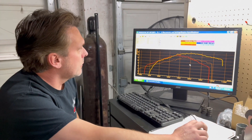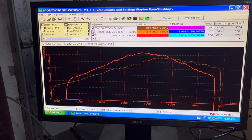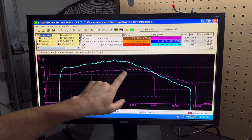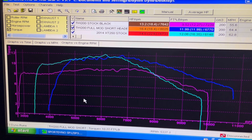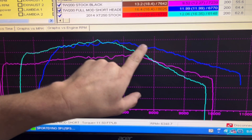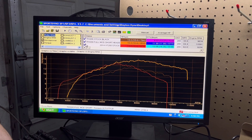But that's not where we ride the bikes at all the time, so let me show you something really cool — let's look at torque numbers. Here's the XT 250 torque versus the stock TW 200, and we'll throw mine back in there. Mine is the blue line. I'm currently making about the same torque as an XT 250 up to about 6,800 RPM, and then carrying a whole lot more torque out a lot further than the XT.